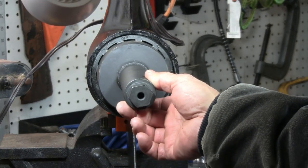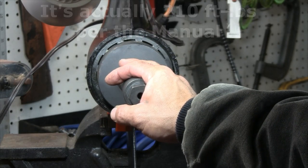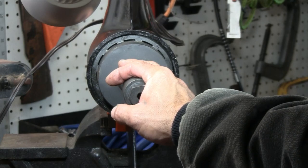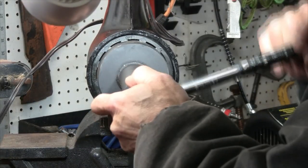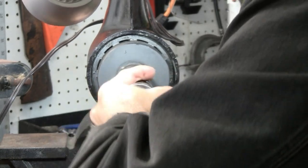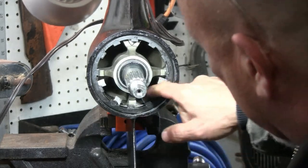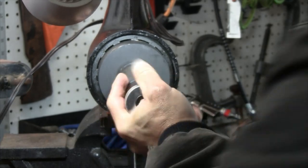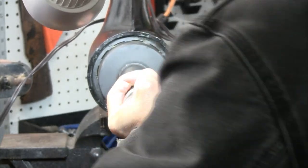This requires 220 foot-pounds of torque, but I'm actually going to mount the lower unit before going any further, because it would be quite something if I managed to break the shaft off while having it mounted in a vise. I'm going to go as far as I can manually, then we'll go for the final torquing. I'll make sure the locking ring stayed in place, then take it out to the boat, get the lower unit mounted, and apply the final torque.